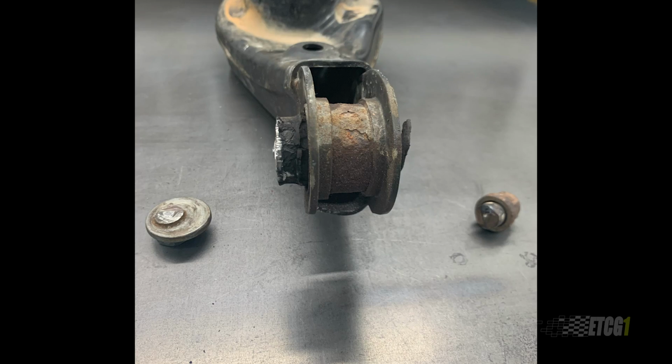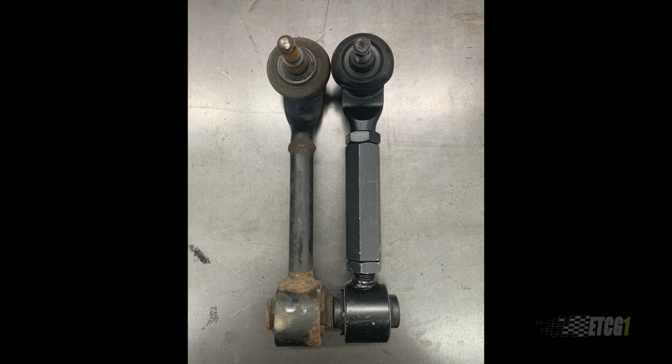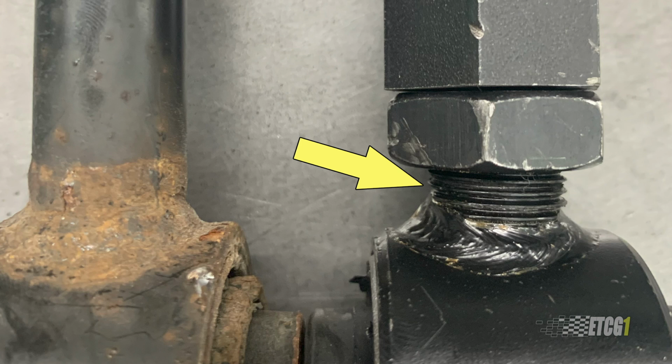And if you've been keeping up with the stuff I did to the Honda Odyssey, you also know I had a little bit of a fight with one of those cam bolts back there as well. So I had a little bit of fun with the rear suspension on the Odyssey over a couple of weeks. Anyway, I took that amount out of that center section and threaded it all back together. And here's another important note. When I put everything back together, I tried to make sure all the empty threads were on the inside, the part that attaches to the body of the van.